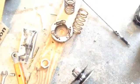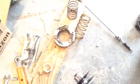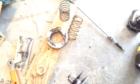And again, this clutch nut that sits on the top when you pop the spring off, I thought, oh, I just took it off. My feet are on it really strong. I told my kid, move out of the way, this thing could explode. And then it just pops off so easy. I'm seeing all these videos saying watch out. I guess because I am working on a 90cc bike, we are talking about a small spring. If you had a really big spring, they might have some sort of issue maybe, but I don't know. This spring just doesn't have much tension on it. I put my feet on it, it barely even pops. So okay, I'll pause for now.